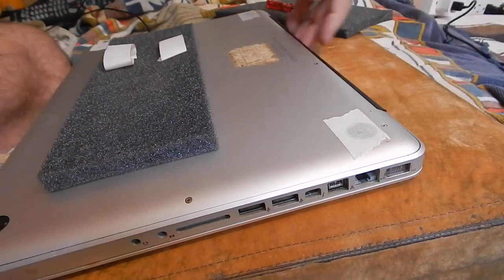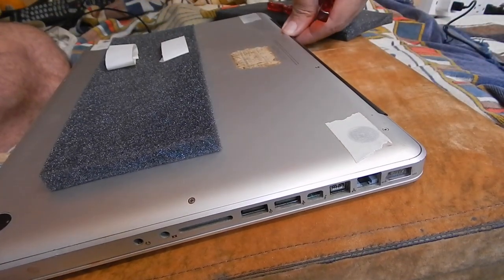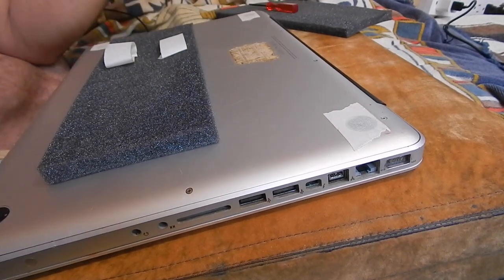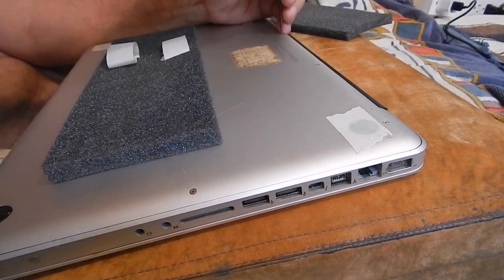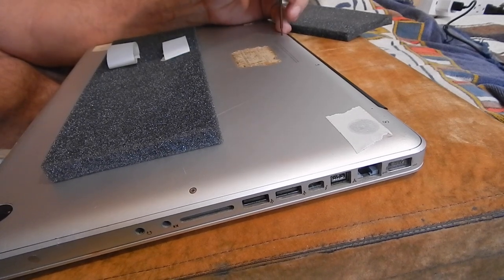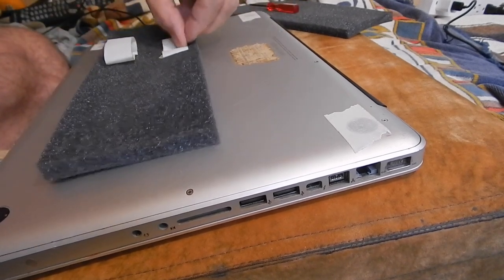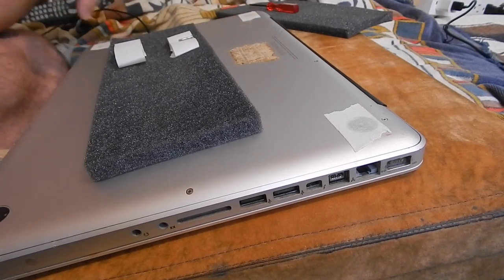Now, on the hinge part, where it has that black plastic, these right three are long ones. We'll just take one of these out. Make sure I have the right driver. Because you want to be pretty careful, especially the initial part of these. Yeah, the idea is you don't want to strip these. That would be a long one. You don't want to strip them, and I like to keep the same ones in the same hole.